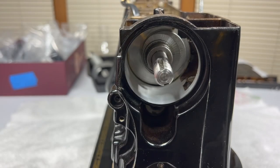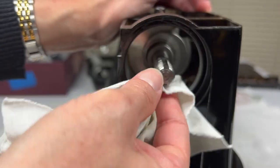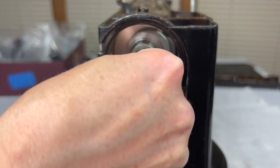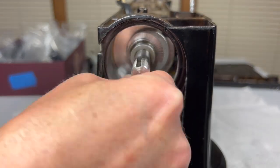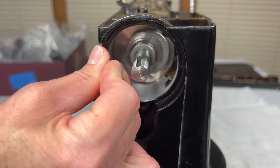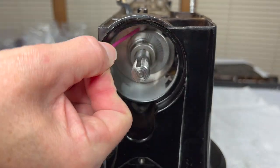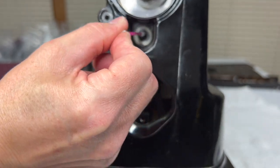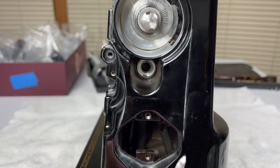I'm taking a T-shirt with rubbing alcohol and wiping all inside the hand wheel to get out the extra grease. Once fairly wiped clean, I'll come back with a Q-tip dipped in rubbing alcohol and keep going into all the little crevices that were harder to reach with the rag, scrubbing away at the varnished-on oil until it's all off. Also remember to check all the holes everywhere on your machine — everywhere a screw goes — and use a Q-tip with rubbing alcohol to swipe inside each hole.